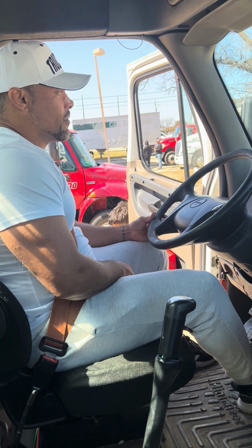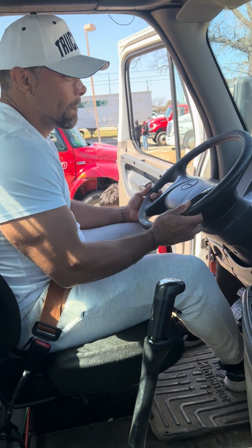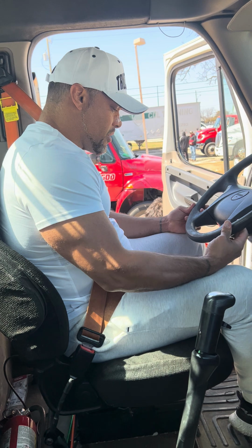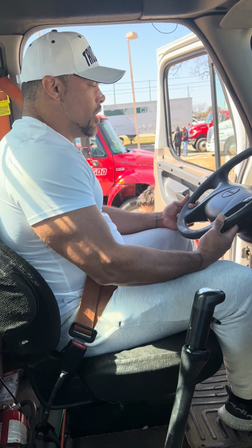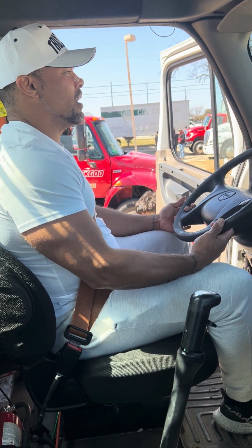Okay, as I'm waiting for this test to take place, I'm listening for air leaks. And that's 60 seconds and I lost no more than 4 PSI, which means that brake test is complete there. For my next test, I'm gonna test for the emergency brake signal and signal light.